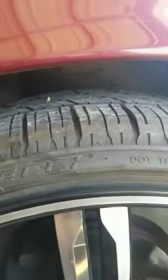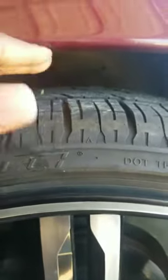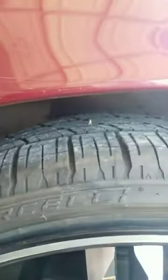Because when you ride and you come down, since you got the poke and the tire don't sit inside the fender, this is going to touch the top part of the tire. So you gotta make sure it's up enough and make sure that the springs and everything is good and stiff. So when you hit a bump or something, you come down, you come out the garage, or you come out the driveway, this part don't come down on the tire and rub.